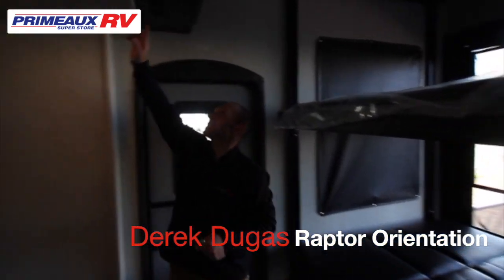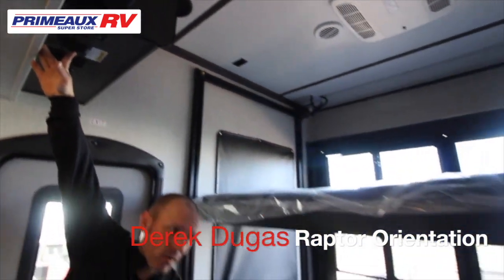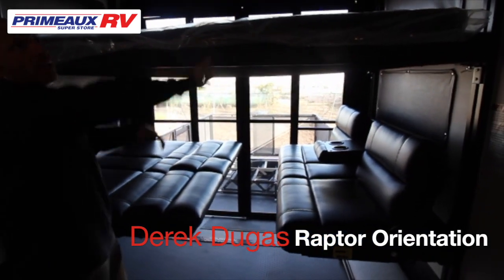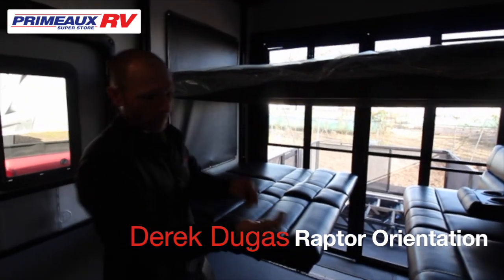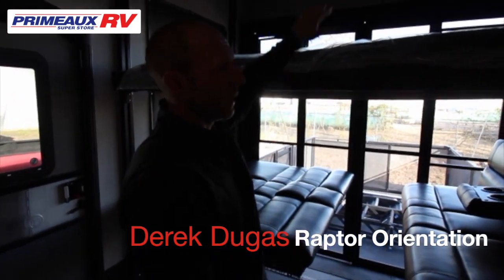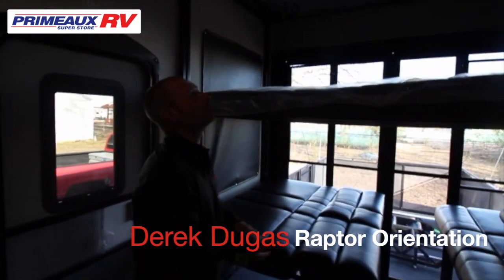Now the control for that is here. You just hit up. You have to have both of these down. What happens is these bottoms are gonna hit the top, and then it'll pick them up. Now if you wanna keep this bed up, once you pick it all the way up, there's 4 pins. You're gonna get to the top, you're gonna put the 4 pins, and that'll allow you to drop all this down with the top bed staying up.